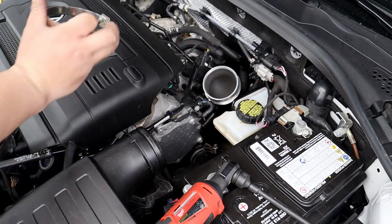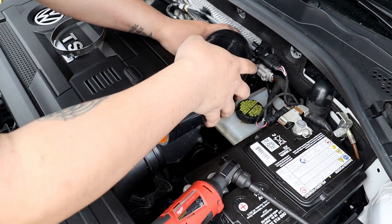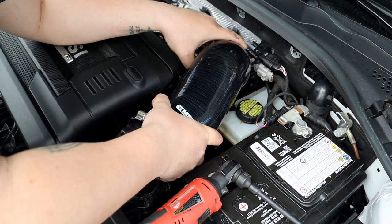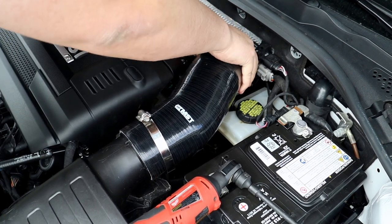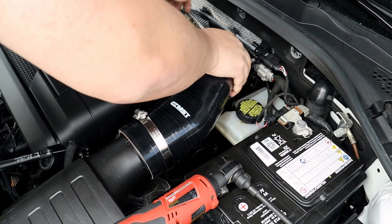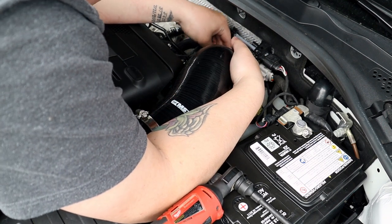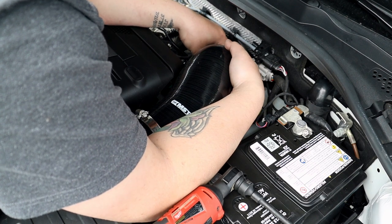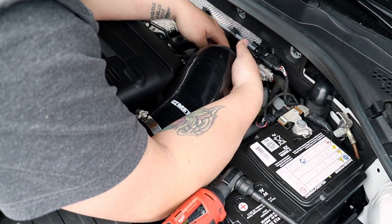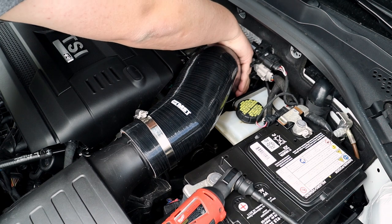After putting the PCV hose and the BPV connector back on, what I'm going to be doing now is getting the 3-inch intake hose from MST Performance and installing that — and also don't forget the two clamps you have to put on. What I like to do when putting the intake hose is put the turbo inlet portion first, then line up the intake box. Most of the time the hose kind of lines itself up and you don't really have to struggle putting it on. I'm just wiggling the hose so I can get it to sit all the way to the back so in case there is high pressure the hose isn't going to pop off.